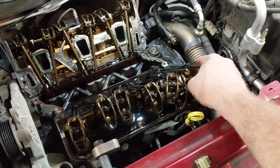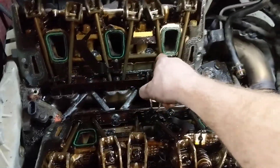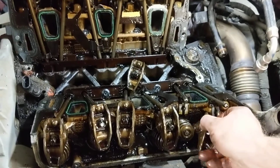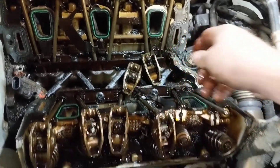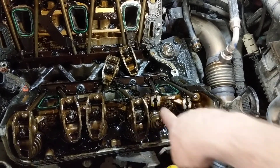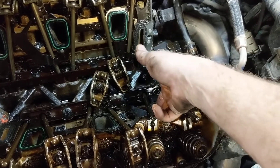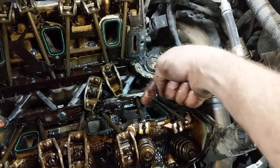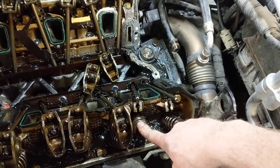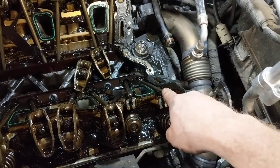You're going to have to order a separate pushrod and rocker. Now, if you need to know which rocker goes to which valve — one is exhaust, one is intake — what you do is go in and feel which way the port goes. Because this port is going that direction, we know this one is the intake. So the exhaust one is the one I need a rocker and a pushrod for.